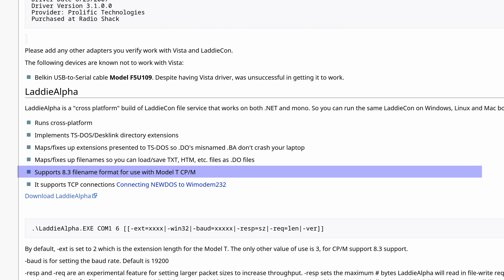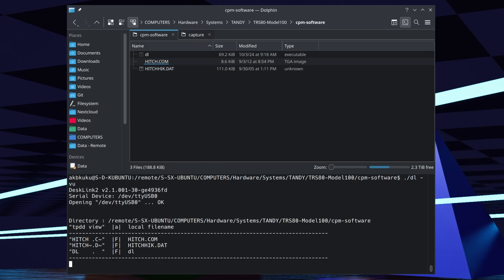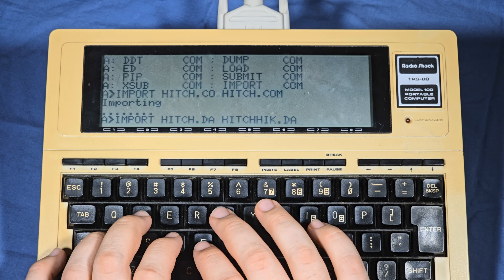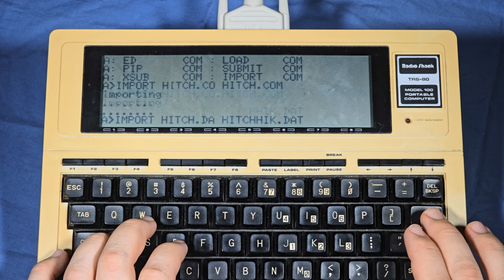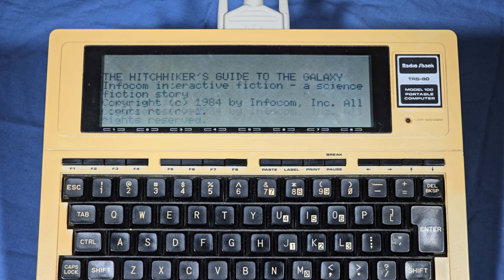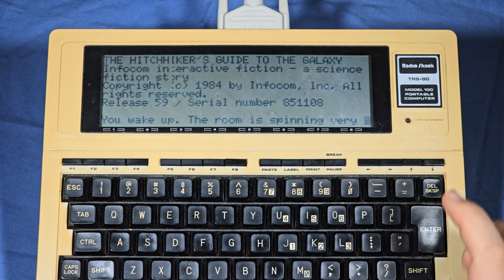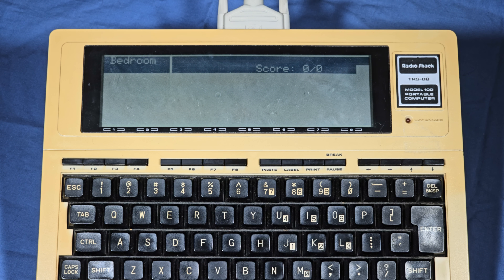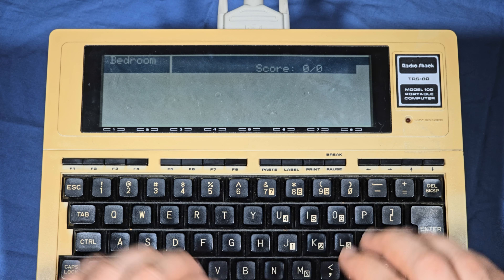The import and export programs act as Tandy portable disk drive clients for loading and saving applications while also renaming them. Some Tandy portable disk drive servers may support longer names — DL2 seems to truncate them. I would recommend renaming any files you want to send to CP/M as 6.2 names, then using the import command to restore their 8.3 name back. To copy files into it you just need to run the import command followed by the Tandy portable disk drive server file name and the original CP/M file name.